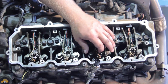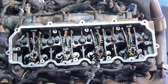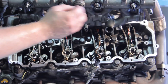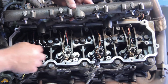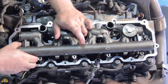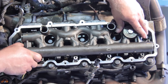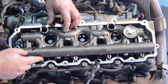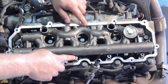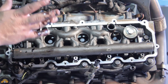There are a couple of O-rings in there that are going to seal against the high-pressure manifold, so we want to make sure that is good and lubricated before we install our high-pressure manifold. Now I can take the high-pressure manifold — these fittings right here are going to set down inside of these injectors, so we need to carefully install this and set it down there. Never force this to go in there. We're going to line this up gently, make sure it's on all four of them, and then work it down until it pops in properly. We should never have to pound this in or use the bolts to draw it in — if you do that, you run the risk of cracking the top of the injector. Now that it's in place, we install our hold-down bolts, install our new dummy plug, the updated two-piece standpipe, put the valve cover on, and this thing should be ready to run again.